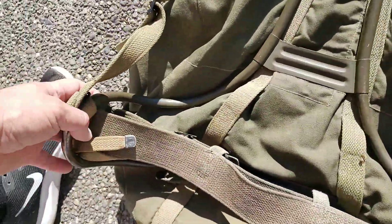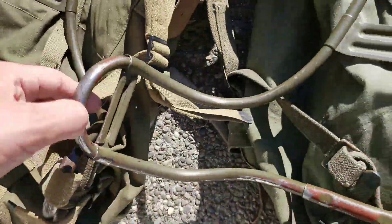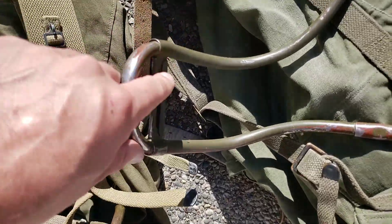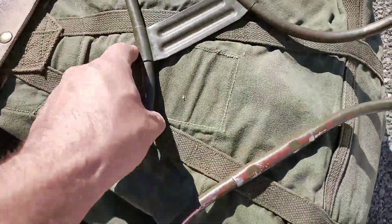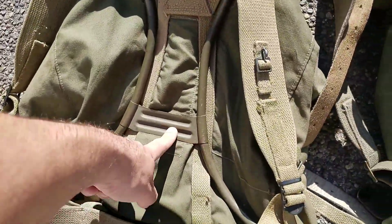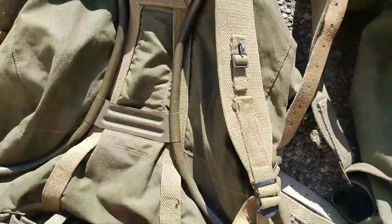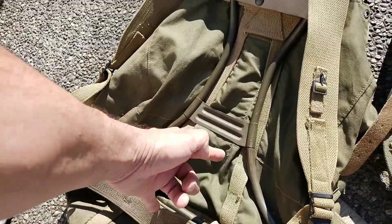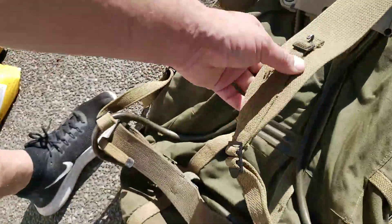Let's look at the frame differences. On the 1943 model you've got a welded crossbar. On the 1951 you have a stamped piece instead, and the same stamped construction on the middle part. The reason they went to this was to save on welding. On the 1941–1942 ones they just had a welded triangle. Otherwise everything else looks pretty much the same between these, with the same attachments.